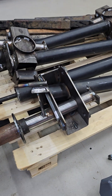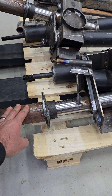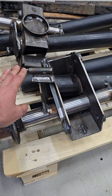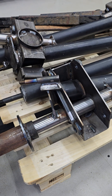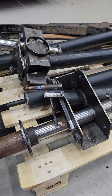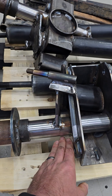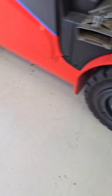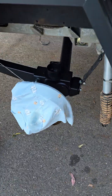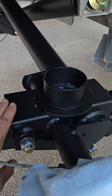Both sets here are to accommodate a van originally at 190 offset. Just ignore these — they're just for powder coat protection when they go. We cover these threads so they look a bit unusual. Because they go to a 12-inch hub drum or 12-inch brake, we have to make a slight change, so these ones are actually 175s — same measurement from here to here, 175. They're ready to go out for powder coat in a product called Protex, which is a very durable coating — much more durable than the original gloss black.